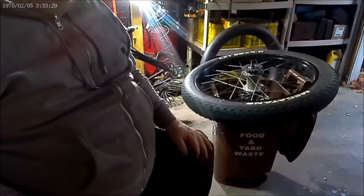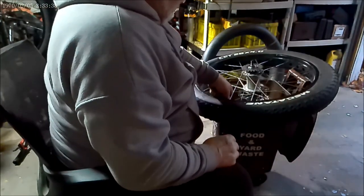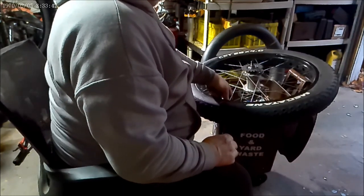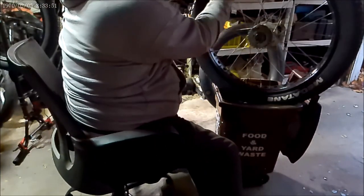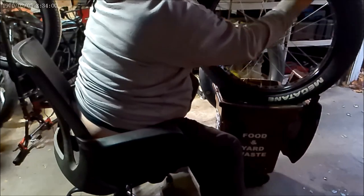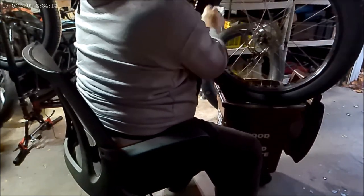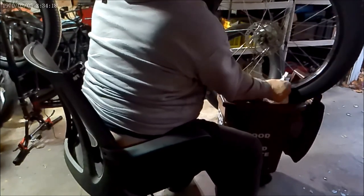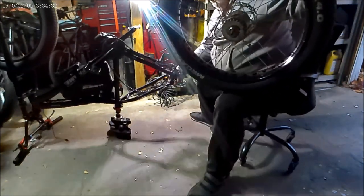Okay, that's it. Now I'll put the wheel back on - lift the frame, slide it over a little bit. Here's where it can go together really easy. Make sure you've got your little notch that matches the frame. Put your chain around, drop the disc side in first, and it'll drop right into place just like that. Then get the two nuts and washers and the clamp.